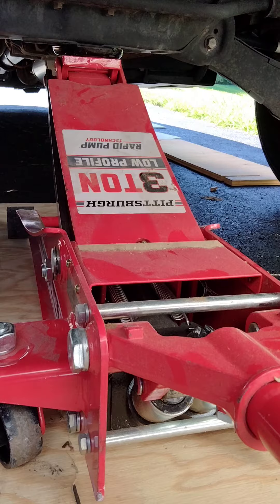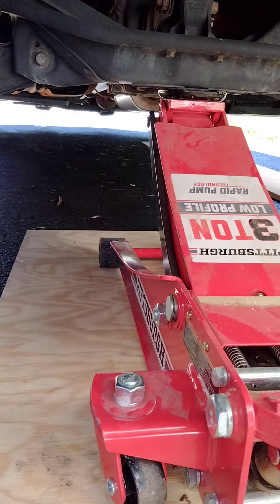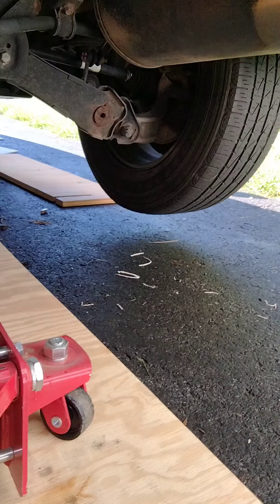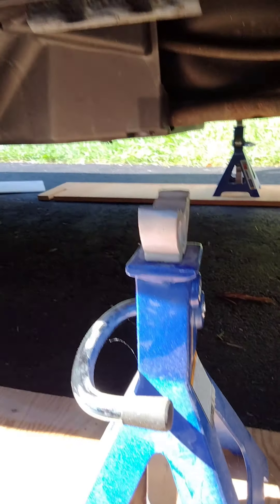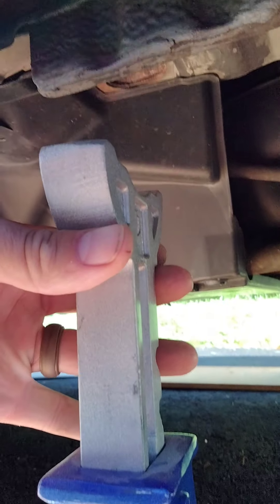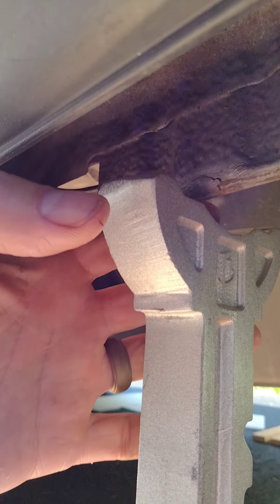As you can tell, you can see the wheels are above the ground now. What I'm going to do is raise it as high as I can so I can put the jack stands — just in case, because when you raise the front, the rear is going to lower. Now you want to put the jack stands where they need to go. If you look under the car, there's a thick piece of metal right here — this thick metal is meant for you to put the jack stands on it.